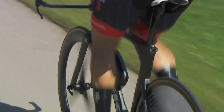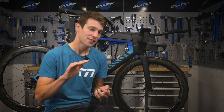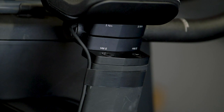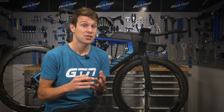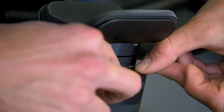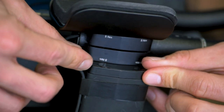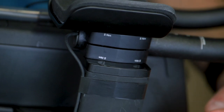If you thought that last one was a little bit over the top, just wait for this one — I'm now going to be covering some of the bolts and openings on my frame. This is actually really popular in the cycling and time trial world where attention to detail is absolutely key. You've got a nice smooth frame, the air flowing nicely over the frame, and then it goes through a little bolt or opening in the frame — it's going to disturb the air just a little bit, but it is still something. We do tend to get quite a lot of bolts and openings around the stem area. So to eliminate that, we're going to use a little bit of electrical tape placed over those bolts and openings. Or to do it really neatly, you can get some nice thin plastic which is taped and sticky on one side, cut that to size, place it on those parts — and you can even get that in carbon effect.